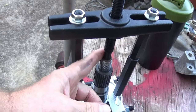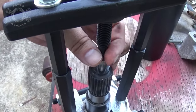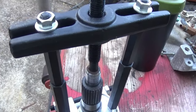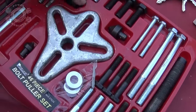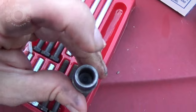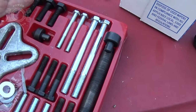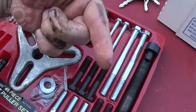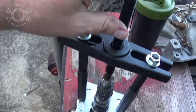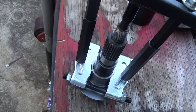I've got the jack shaft put in place. I'd feel a lot better if it had one of those shoes that actually butt against this and allow this to turn inside the shoe. On this set right here, these little pads go up inside the jack shaft which allows it to turn on them and makes it much easier. But this kit I'm using over there doesn't have that. So I'm going to throw the ratchet to this thing and break that loose and hopefully pull it off.